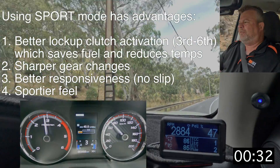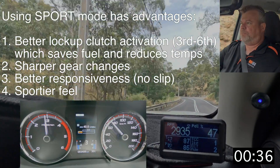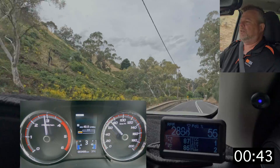That is a bit like having a valve body upgrade — it actually gives you a sharper gear change. In sport mode, that's what this transmission does from factory, and that means you get less wear on the clutches, so that's a good thing for when you're towing.